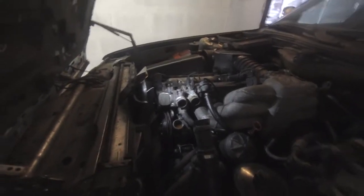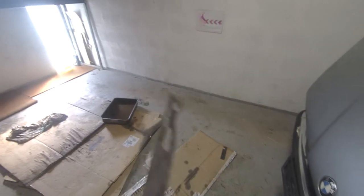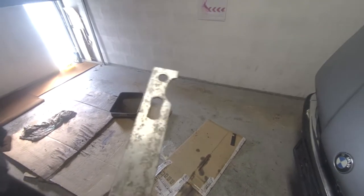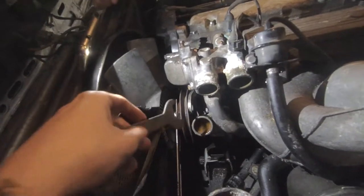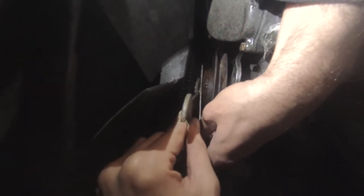Next day — the water pump is still on and the fan is still on, so we're gonna have to deal with that. We didn't have the fan clutch tool so I made one — it's kind of a replica of the original, a bit more sketchy, but it fits perfectly. We actually found the 32 wrench too, which is a bit short but okay. We're gonna use a hammer — let's hope this works. The clutch tool fits perfectly.